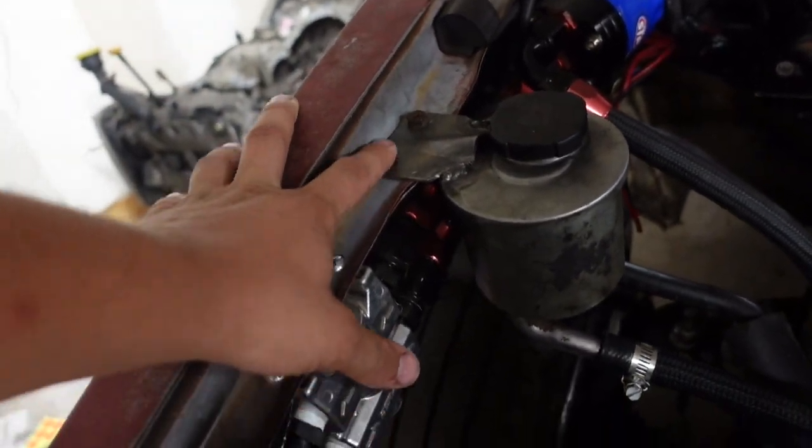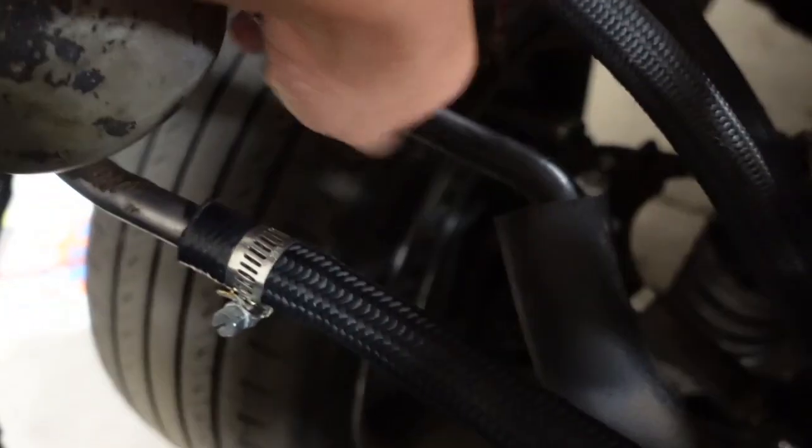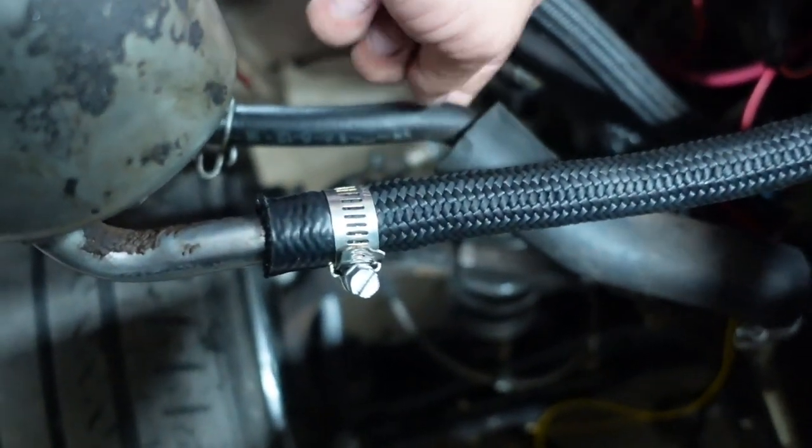The truck runs, everything's good. The manifold's not really bolted on right now, the turbo's not bolted on, but I want to get the downpipe situated. Once the downpipe's situated we'll be in a good place to start tuning. I got my power steering reservoir mounted — I want to put another bolt in it, it just has one for now but it's solid. The feed line is good, the return line I've got to mess with — it's kind of pulling up on this bracket down here. I'd like it to be a little longer. The biggest issue has been the misfire, and now that we have the misfire fixed we've got to button up all this small stuff so we can actually get it tuned.